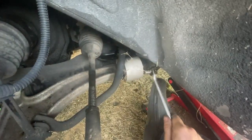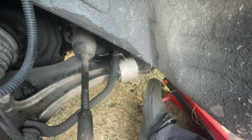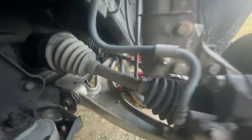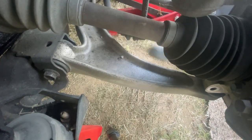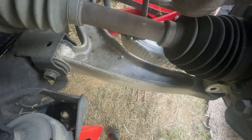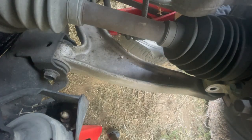Push down on this side, which makes sense because the other bolt faces the other way — you've got to pull up on it. We can do what we did on the other side: aim the camera down and you can watch the ball joint fall out. We can try to smack it out with the hammer first, but I don't think I've got any room to hit, so we're going to do it with the tuning fork — or as most people call it, a pickle fork.